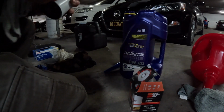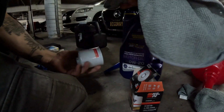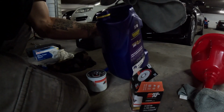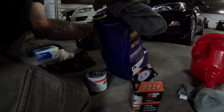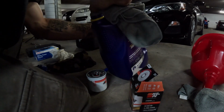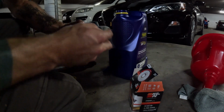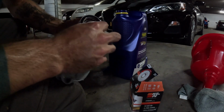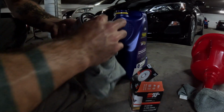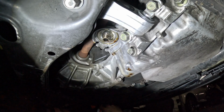So, moving on, as we allow everything to kind of just finish dripping off, we are going to prime our oil filter with a little bit of oil. Don't get me wrong, I don't do this all the time. There's been a lot of times where I've just not done this, but for the sake of showing you everything correctly, now you don't want to contaminate your oil, so this rag is actually clean, it's been washed, but I am just going to lightly dab the smallest amount of oil out of there without really dipping it in, because like I said, you don't want to contaminate your oil before you put in your engine. Some people use their fingers, but I believe that the towel is probably cleaner than my finger, which may have grease or something on it.